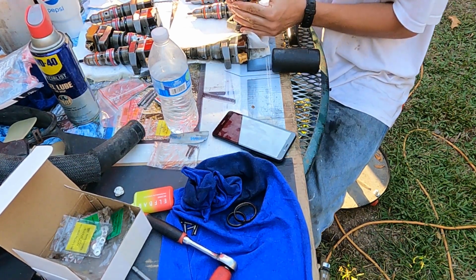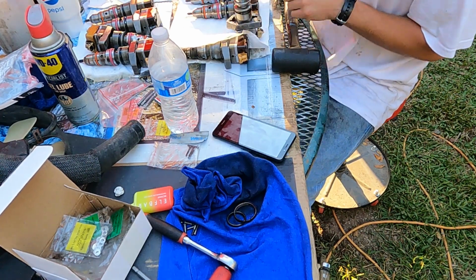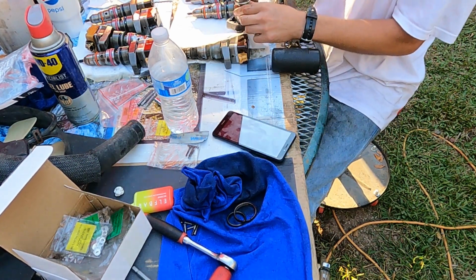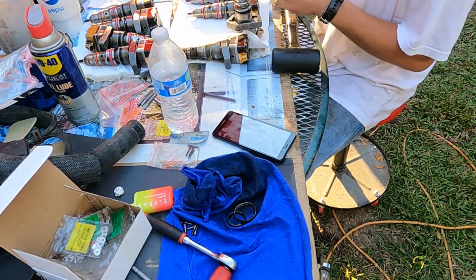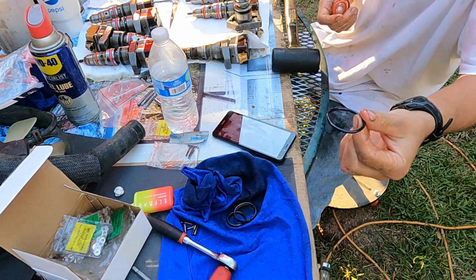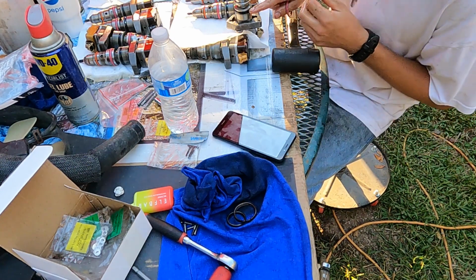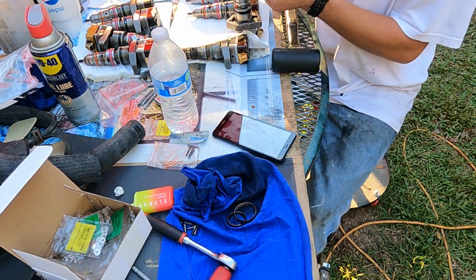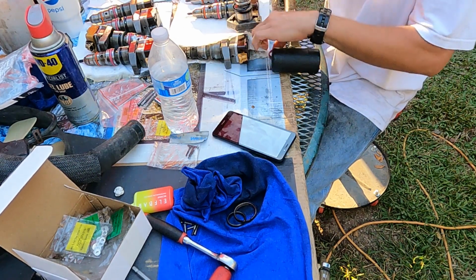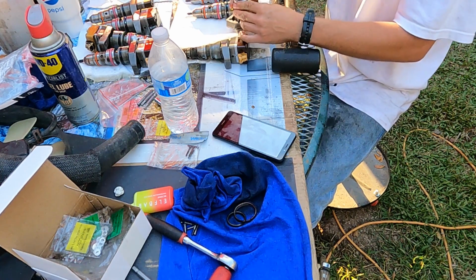They have some white markings on the outside of the square ring. If you flip the O-ring, you won't be able to see them. So you should be able to see two white stripes on the front. Next O-ring to go in is this bigger black one. This is the actual O-ring that seals the pressure. The ones before it were just to back up this one. So we'll put him all the way down.